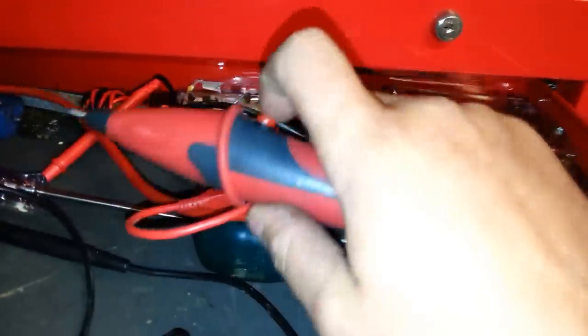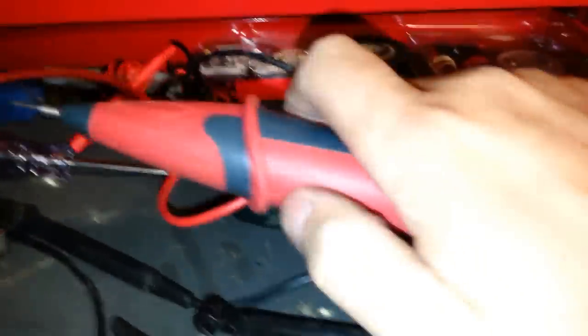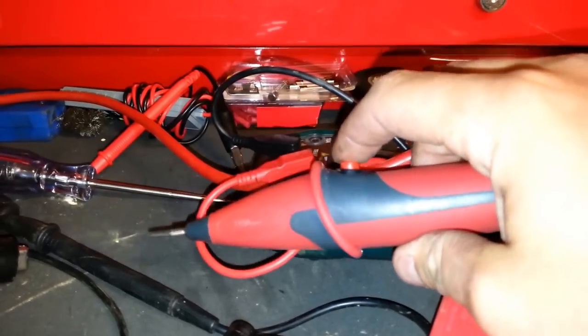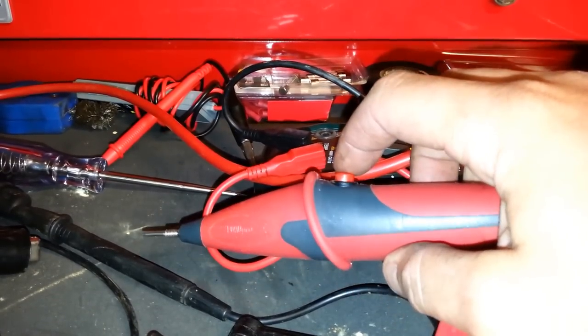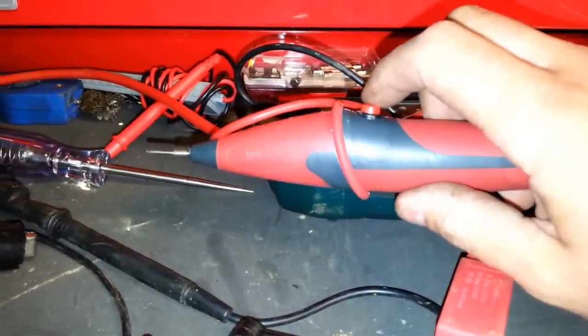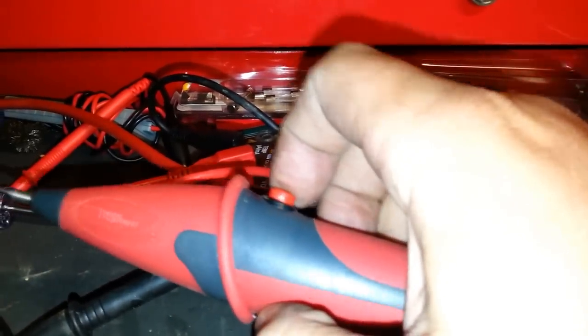You've got this to be your positive and then obviously the ground. What this tool does is you unplug a sensor — whatever sensor you want, say an evap solenoid or whatever — and you're testing it for power or ground. You plug in your ground, then plug this into your hot. The special thing about it is you can load the circuit. You hit this button and it will load the circuit for you. It does its own voltage drop, so that's why I like it. It does a great job for that, and they're not expensive at all.